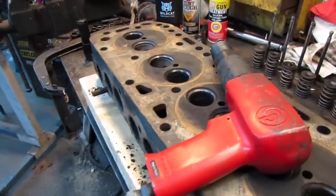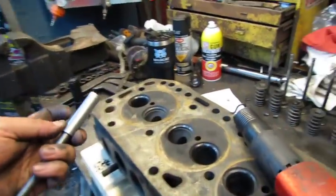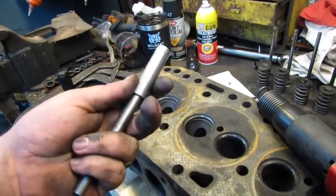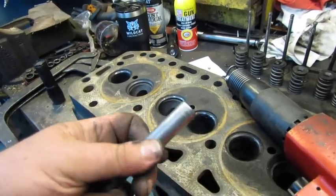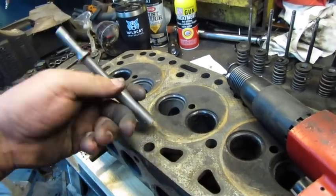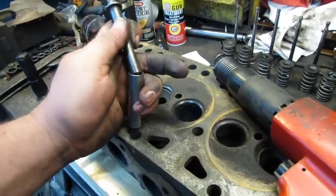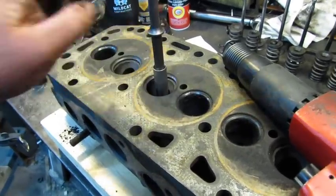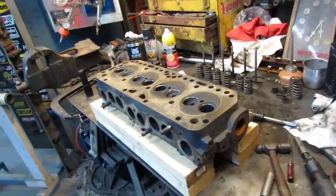Here's what I came up with. Let me take my earmuffs off - I already put them on to protect my ears. I was gonna try hammering them out, but then I realized I'm old and a little bit lazy. So I found a 7/16th deep socket from my extras pile from my pawn shop days, and I cut the end off a broke chisel for my air hammer. Look there - slips right in there. I'll bet you that air hammer drops them right out. I'm fixing to find out - well, that works slicker than snot.